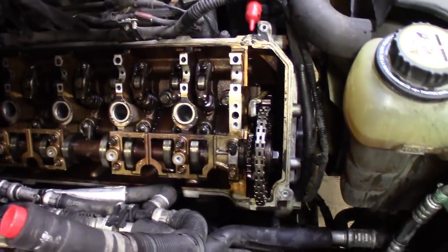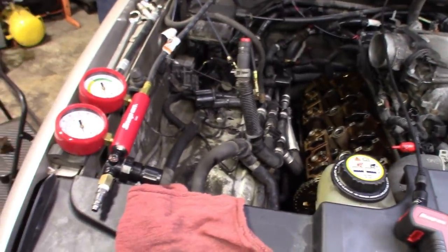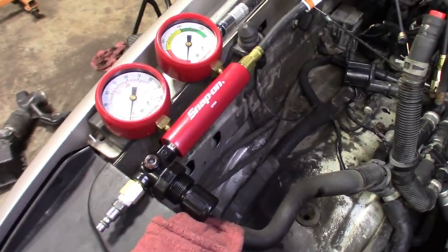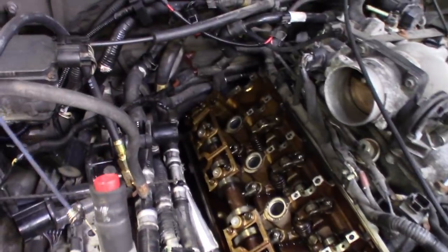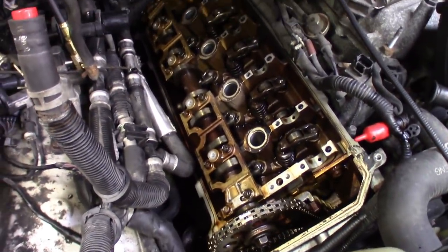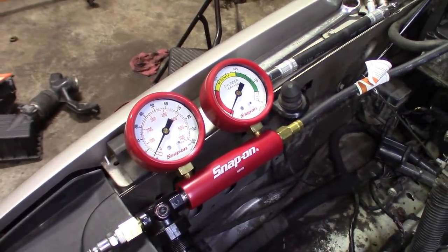Wanted to go through the process. If I'm going to time this, I've got to find out and make sure the valves are good, make sure the cams are good, kind of see where we're at from there. With that chain snapping, there is a chance it's going to kiss some valves. I got the camera out, was poking down in there. Didn't really see anything on any of the pistons. So I'm going to shoot this over to a Tools in Action segment and show you guys how to do a quick cylinder leak down test on this. I checked three and four already, but I'll check one and two on film here. I had a few subscribers ask to see this cylinder leak down in action, so let me get you guys set up.